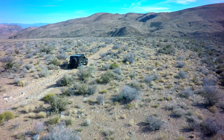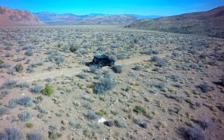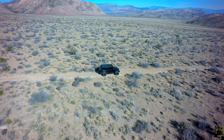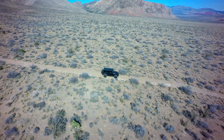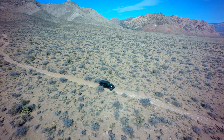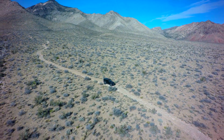Of course, there's a downside to everything, and running a GM engine with a Chrysler transmission is not compliant, of course, because the transmission is part of the emissions control system. You have bespoke and custom hardware to interface that engine into the Chrysler operating system, which is not going to be readily available at your local dealership, and it might be difficult to find servicing and replacement parts.